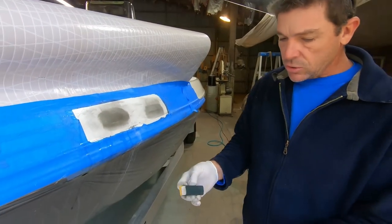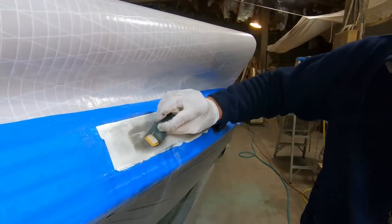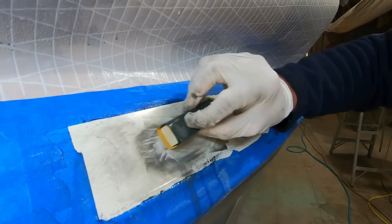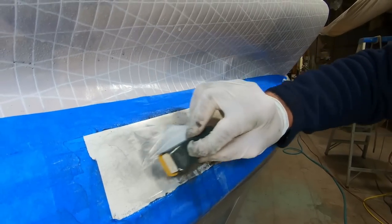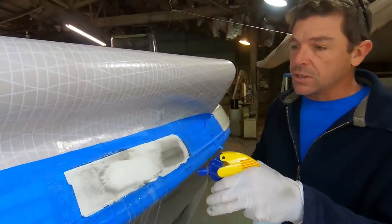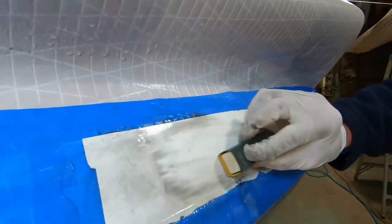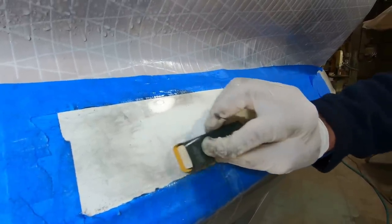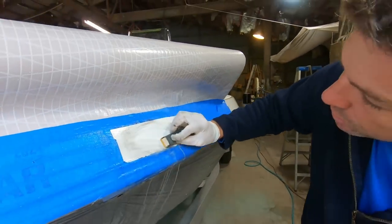Here we go — a little bit of water with a mild soap solution. Most folks could do this — just need to follow the steps, don't be in a hurry to skip or improvise. This longer block is going to put very fine scratches — 1000 grit — and it's going to start to really fair this repair job out and blend it. It's already starting to really go away. Very light hand, just using finger pressure, and I'm starting to work my way out a little bit further from the original damaged spot. You progressively work out — hold tight with 400, a little further with 600, a little further with 1000.